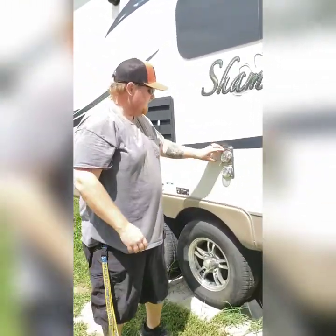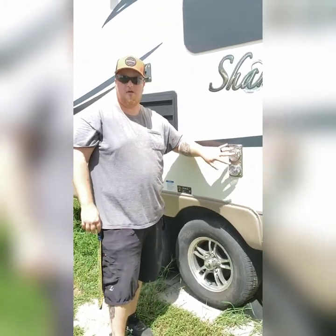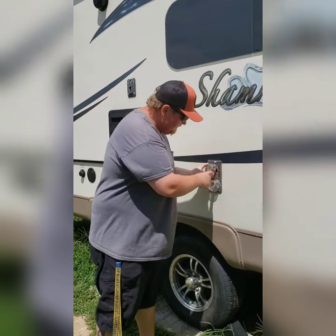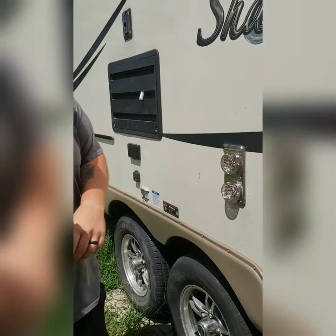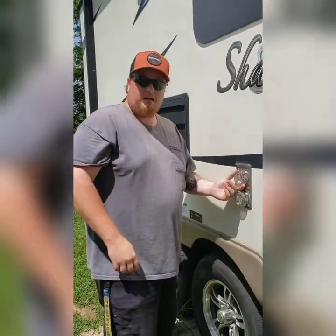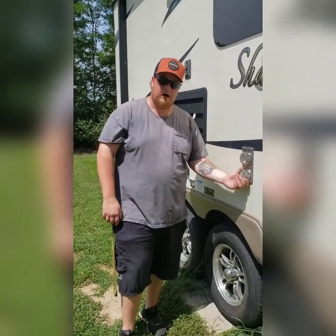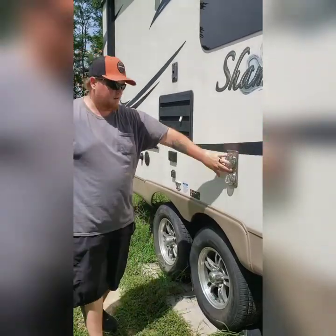The next thing that is definitely a necessity — these screens do not come on the camper; you have to buy and install them separately, which I did in about three minutes. If you move them out of the way, you have holes here for your kitchen system — your refrigerator, stove, microwave — it's an air-breathing system. Mud daubers, wasps, and bees will get in here and build nests and clog your system up. So this keeps all the bugs and critters out so you don't have to go in and take it all apart and clean it out. Must have.